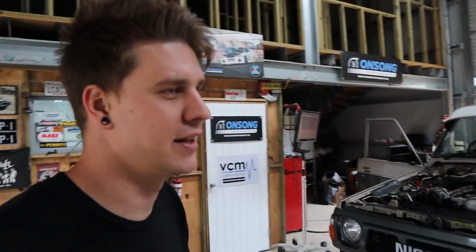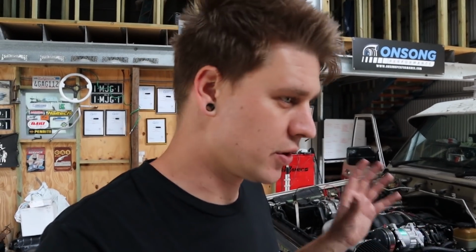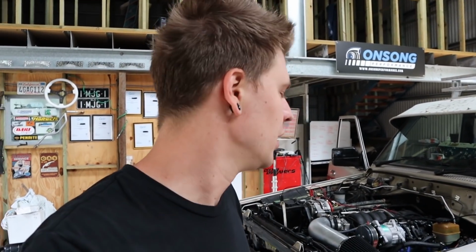But for anyone who's worked with E38 PCMs before, once you start trying to flash different OSs into them, they're very sensitive. It's really easy to hurt their feelings. So they get sad and they lock you out and they do all sorts of funny stuff. So there's a lot of risk involved in just trying to smash another OS into a PCM that's not coded for that VIN. Without going too far in detail, it's risky. So we're trying to sort out a way that we can try it and know that it's going to work without it costing us heaps of money and licensing for other HP Tuners. We're trying to sort that out.